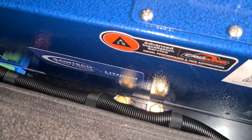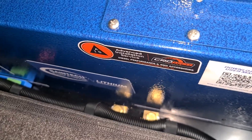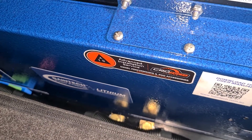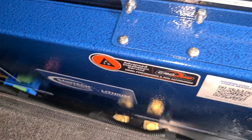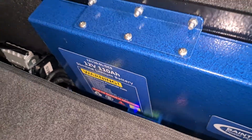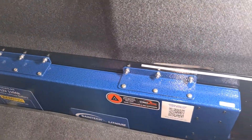You've also got your battery monitor — smart shunt — that pairs with your phone so you can monitor the voltage on your battery system, all from your phone. That allows you to see how long your fridge will run and how much current's going in or out of the battery. It's also coupled with the Victron disconnect, so it'll protect the battery. And a couple of Andersons down there, so it can all be unbolted and unplugged within a few minutes.